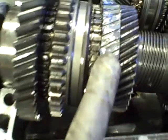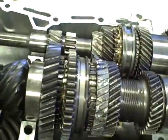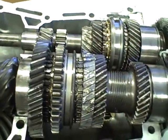On the opposite side of second gear, same thing — all the teeth are gone. And then the synchro back here got eaten up and threw stuff all over the place and took out the third and fourth actual shift pack. Now these need to be updated because you can't just buy this one. So this car has a major, expensive failure.